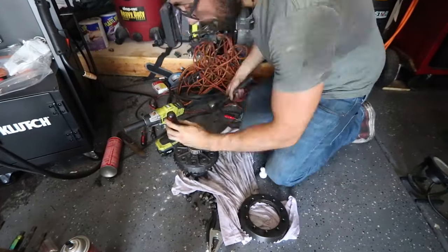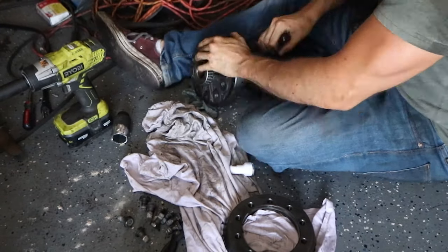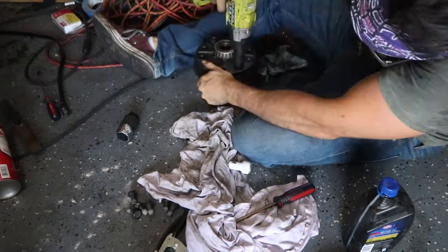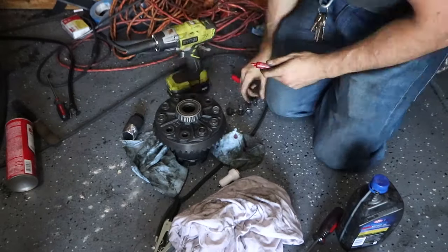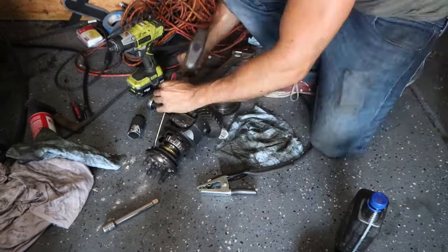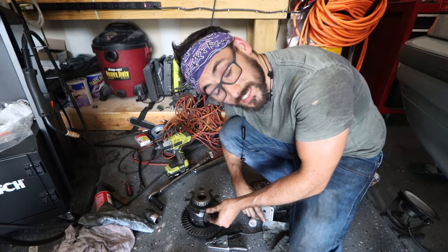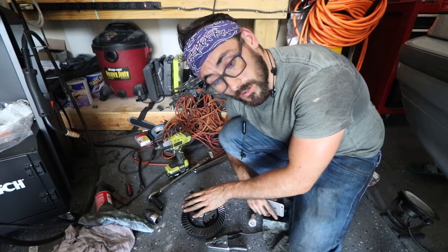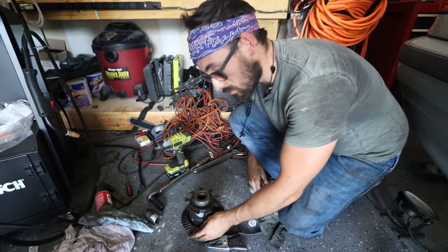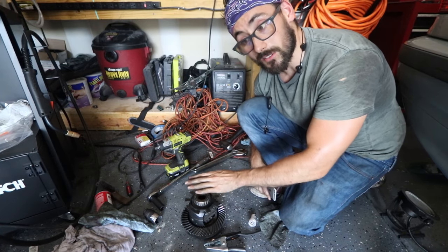Now I'm working on removing the ring from the differential. The old one was kind of stuck on there - ultimately you'd want to use some heat to get it loose and smack it away until it broke loose. Then I took the new ring and went to go fit it on there. It was having a little bit of trouble, but I got it lined up as good as I could and pressed it down far enough to get some bolts in to pull it on. I also used red loctite on all of the bolts just to make sure it's not going to come out. I reinstalled the speed sensor ring and it should be good to go. I just had to hammer the tabs out of the way, slip the ring off, and hammer it back in place.